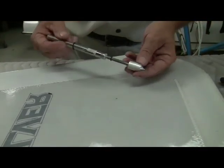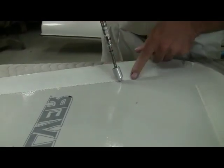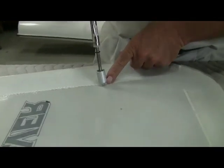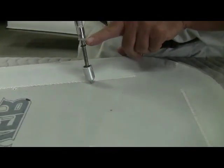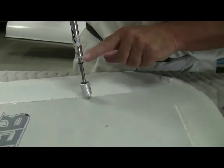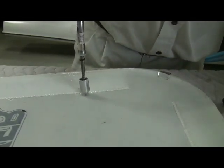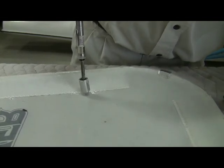I'm going to put the tip on the fabric next to the seam, because the seam is the weakest part of the fabric. I'll put it right next to the seam and push down until we get to our o-ring. If it goes through before I get to the o-ring, this surface is not serviceable. We'll keep pushing till we get to 10 pounds, and if it doesn't go through, it's okay.